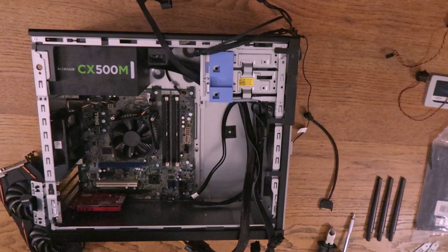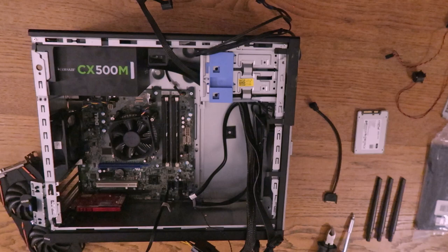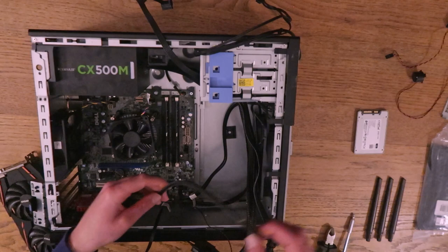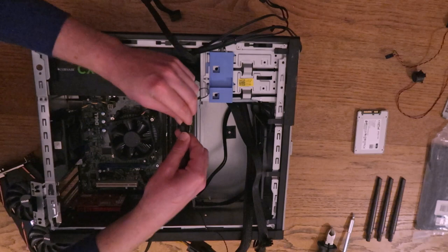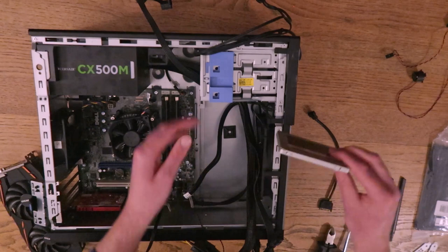I've definitely done this in the wrong order — this is tight. I think I'm going to take it off. So then I can install this cable and also install the thermometer. I want to install the GPU as late as possible just in case I need to access anything else around this area. I'm going to plug in the last cable which is the adapter for the front fan. The hard drive I'm going to bolt down just here and just there.